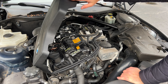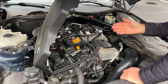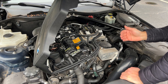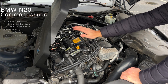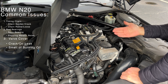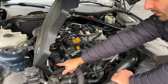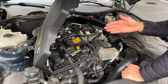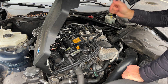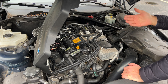I moved the cover to the side and removed the insulation. With the scary items out of the way, let's talk about some of the more common issues that you can probably DIY or get done without spending a fortune. Just like with the N52 and N53 engines, the valve cover — which is this right here — is plastic and has a tendency to crack and or leak oil. This wouldn't be a huge problem, but it usually leaks all over the exhaust, which will damage the O2 sensors attached to the exhaust manifold in the process.